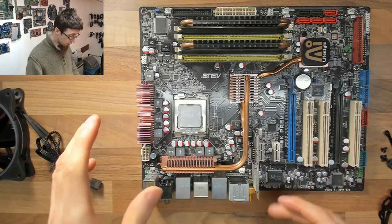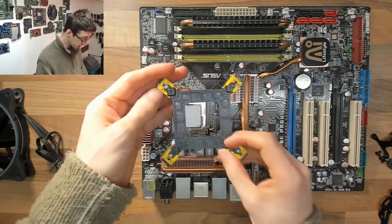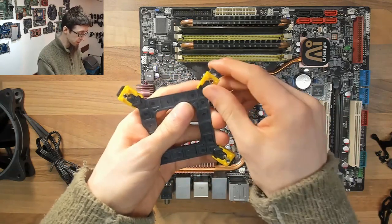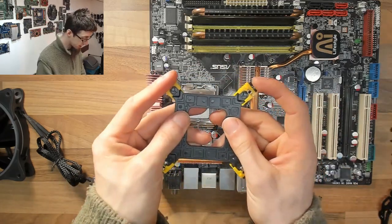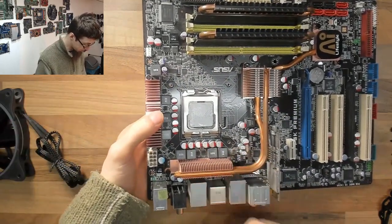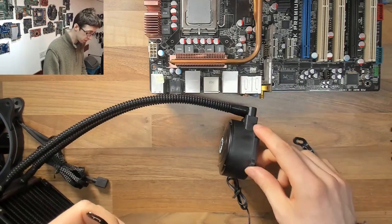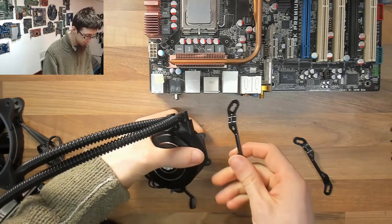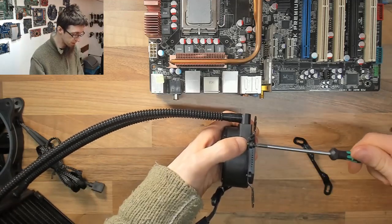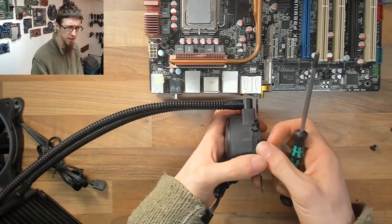For a quick test setup, I've got an old Intel system here and I'll show you how to set up the Iceberg to fit to an Intel board. For your Intel mount, you're going to need the supplied backplate. This has adjustable arms on the outside to fit whatever Intel socket you have, so adjust these arms to wherever they need to be for your particular socket and position it at the back of your motherboard. The pump head requires the Intel brackets — these long ones — which bolt onto the wings at the top and bottom of the pump, laying down over the top and screwing in from underneath. Make sure you refer to the manual for which screws to use, but the instructions are quite clear so it's a lot easier than it looks.